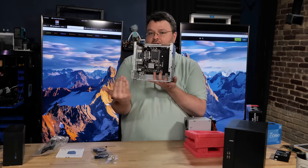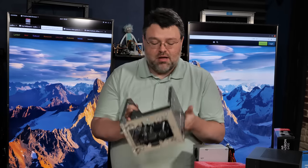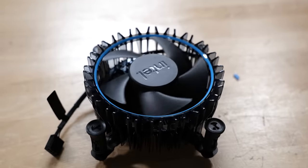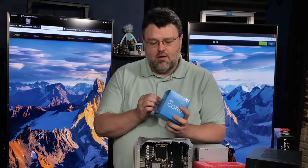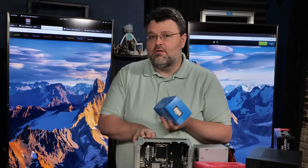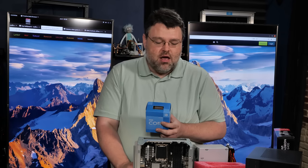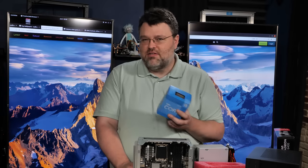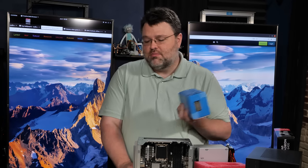This is also the maximum length of GPU you can install, which is 200 millimeters. There's room for a fan on the bottom, and you could even do a 140mm AIO if you want. With Intel builds like this 12100, it comes with a boxed cooler. All non-K processors come with a reasonable boxed cooler — the i3 comes with the Laminar RM1, which is the same as the i5-12400. Generally, the i5-12400 with its six P-cores is my overall recommendation. If you shop around, you can find it for less than $200 — that's a steal for that many Alder Lake P-cores. The 12700 would also make sense here. The boxed cooler comes with it and it's basically everything you need.